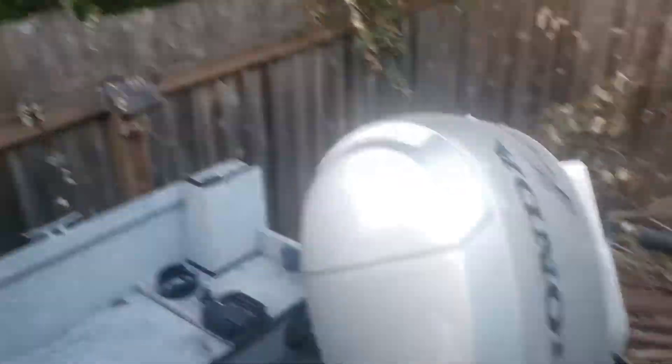This thing has been out on the water. It is water worthy. Oh, the bilge pump is another interesting thing. I haven't torn the floorboards up to actually look, but there's either not a float switch or a non-functional float switch. We started to fish for a while and a few hours later kicked the boat up and put the big motor down, got it up on plane — and it was very wishy-washy and handled very oddly. Hit the manual bilge pump switch and we gushed water for five minutes. Maybe that's where that random hot wire that ran down into the bilge and wasn't actually attached to anything went. That seems likely, but we'll figure it out later.